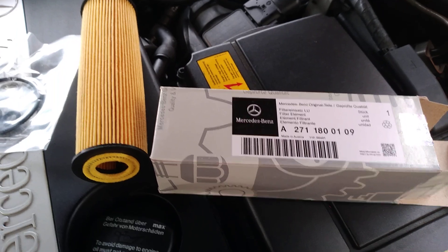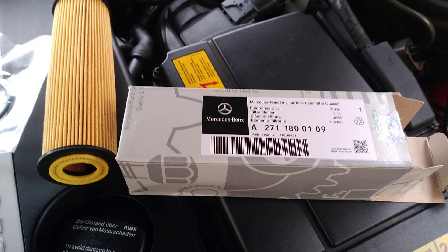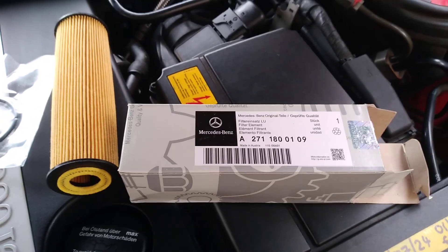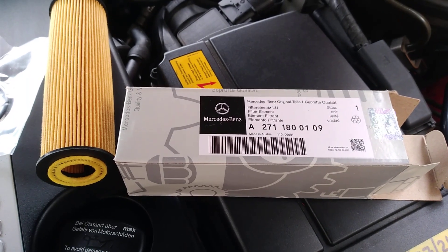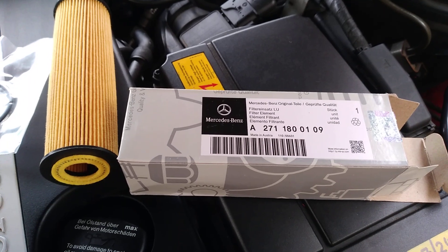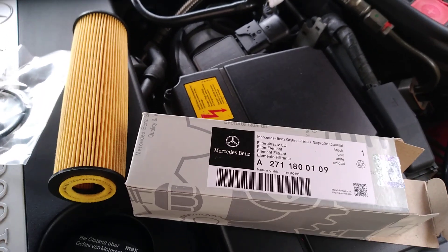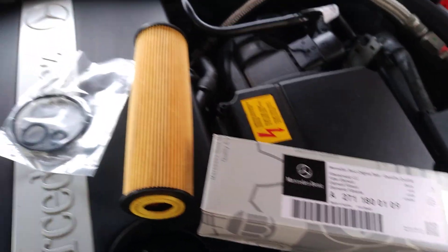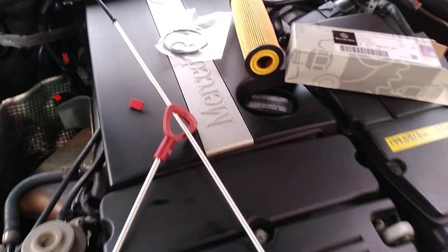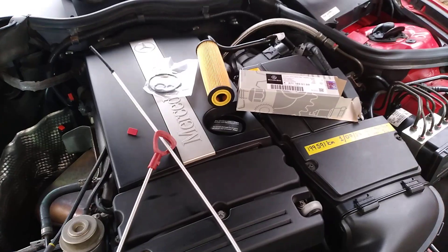Once I've done that, I put the cap back on and give the engine a quick turn-over but don't let it catch - just a couple of quick cranks so it's turning over. Then I let it catch, so I don't have it running dry. I would never change the oil then immediately start revving the engine before the oil has had a chance to circulate through all the journals. Take care of your car - the more you do, the less issues you'll have with maintenance and wear down the track. It's an easy task to do.